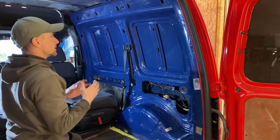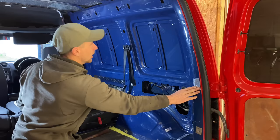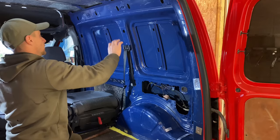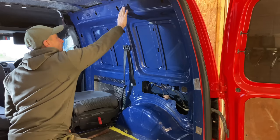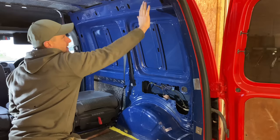The first process I like to do is fill all these holes up. They act as a wind trap — if you ever drive down the road and hear wind whistling, it's probably coming from these little holes. I get aluminium tape — it's just metal tape you can get from any builder's yard — and stick it over all the holes. That way when you carpet stuff, the carpet doesn't just fall right in and you can see little ringlets everywhere.